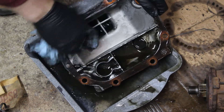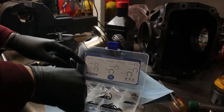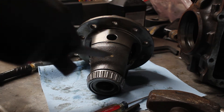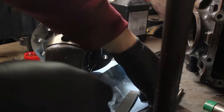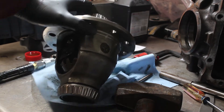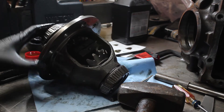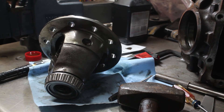In the meantime, I continued cleaning up the differential because it was still pretty dirty. The box finally arrived with a whole bunch of sizes — the size you need is 18mm, which I had measured previously. This one also failed. The pin has a chamfer on it which is supposed to help compress the o-ring, but it wasn't completely all the way down to the shaft, so I filed it down in hopes that it would help. This one also failed, but I tried it again and I think I got it that time. The only thing I'm confused about is how this part is now recessed — it looks like a solid quarter inch too short. And this side is just barely flush because that snap ring goes into that groove. I don't know what to do about this, but I guess I'll just put the screw in.